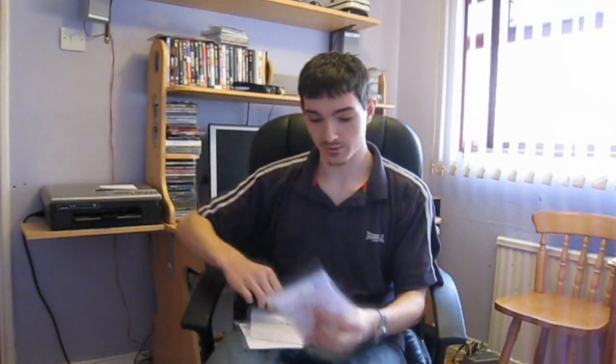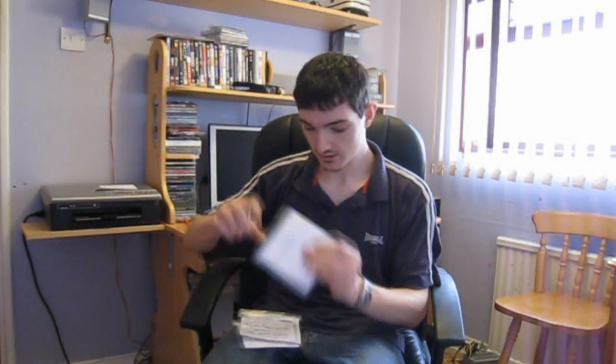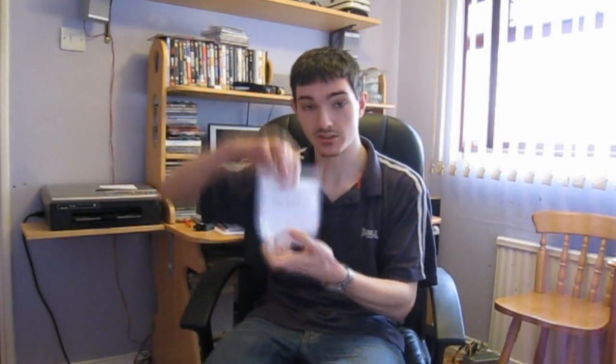First thing is to grab a couple of these — I've got loads of these bags here. They're just basically little cheap sealable bags. I've written on them: power circuit board, main circuit board, 33/45 start and stop and power switch, pitch fader. I've basically just written on bits of paper in each bag what screws I'm going to be taking out, and then as you go, when you take the screws out, bung them in the bag, seal them up, and you won't lose them.